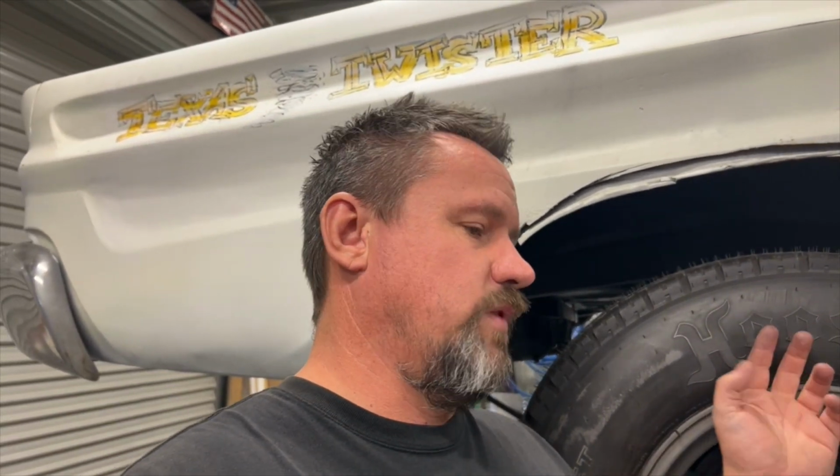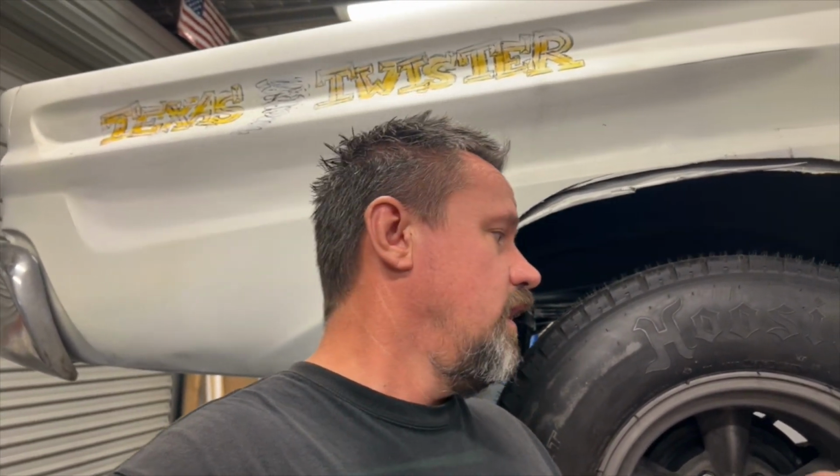And really, for a DOT approved radial, there's not much available size wise that's close to this. It's not like I could have just got the next size down. There is no next size down. It really drops dramatically in size. So, I think this is going to be fine. It's not a massive amount of clearance we need to make underneath this car. I'm pretty lucky in a way. It's just going to take an inch out. We'll give the tub an inch. It'll be completely fine.